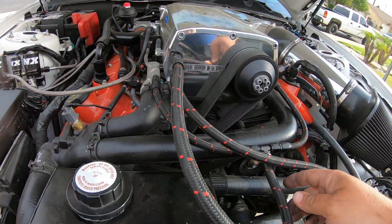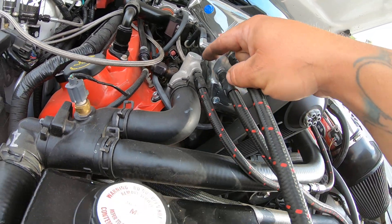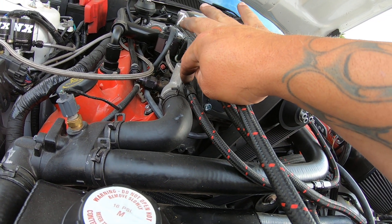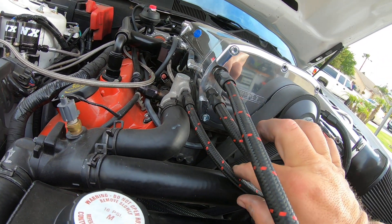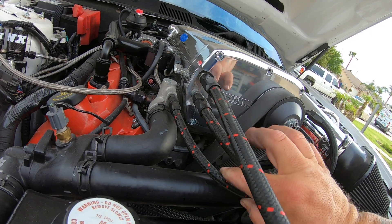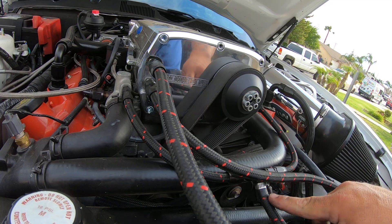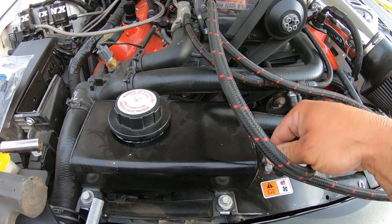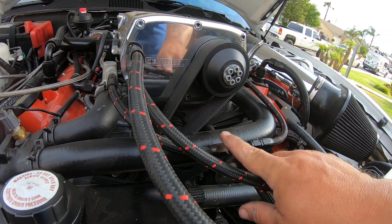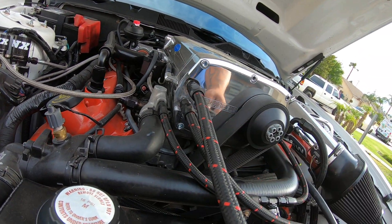So this is my feed - I made these myself. While the intercooler or the lower was off, I drilled and tapped these for a number four AN fitting. I didn't like the rubber hose that was there, it looked tacky to me, I wanted it to look nice. So this is a number four and it goes into here - it used to come off here and connect to your coolant reservoir. So all I did was got a T, the two fours, and then these are two sixes - the six comes across here.